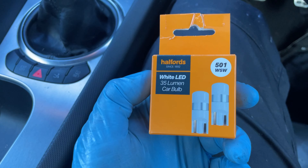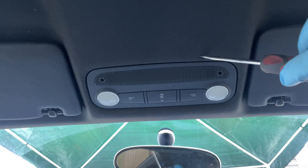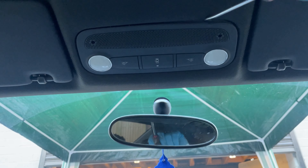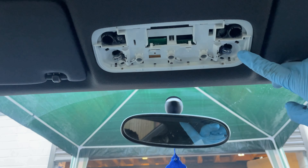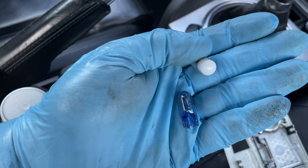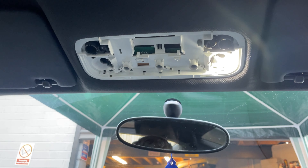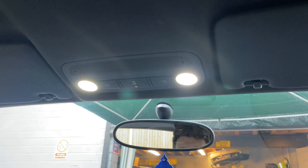While we're on the subject of lights, I've bought some new LED interior lights to get rid of those old orange ones, and again just to help make the car look a little bit newer. While we've got the time we might as well fit them. To fit these lights is fairly simple — just get a screwdriver or a pry tool underneath the edge and pry it down, try not to scratch or damage the light itself on the inside. You'll see it slowly just comes forward because it's just on clips. Pull that down, it's off, and there are the two bulbs — just pull them out and pop your new ones in. The new ones are pretty much the same as the old ones, they're just LEDs, and hopefully they'll be white and a lot brighter. Push the new ones in place — you can already see they're coming on and they're a lot brighter. Get your cover back on. Now they're fitted and they look a lot better than the old dingy orange ones.